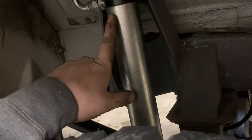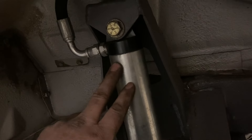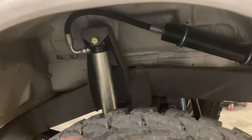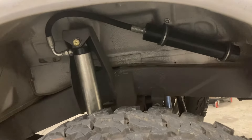My little Samurai that I'm bringing back from the dead — my eventual goal is to put coilovers on it. I mentioned before I want to sit about two inches lower than this one, so I'll probably be running 2.0 by 8 coilovers all the way around. I'm going to do a real simple link system — mostly for street comfort more than off-roading.